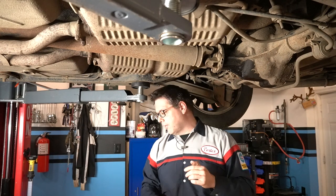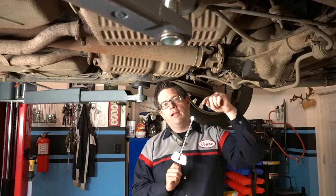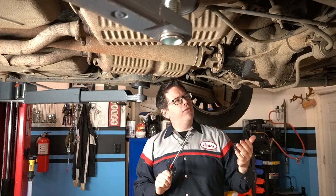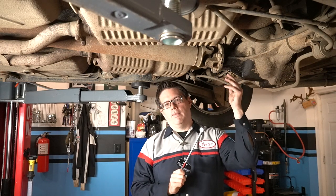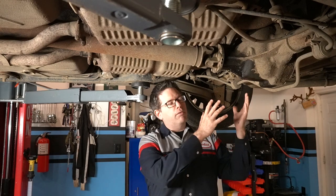Today we're going to use an inch-pound torque wrench — something that would have been used to set drag on the pinion nut to verify preload during assembly. During assembly there's usually nothing attached. But now with this car, even with the driveshaft out, you still have the ring gear, differential, traction lock if equipped, axles, brake calipers, and wheels all adding drag to the system. Fortunately, the service manual accounts for that.